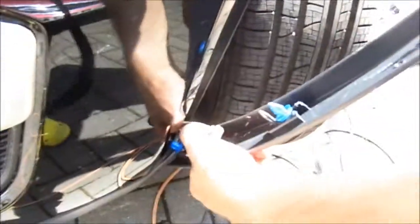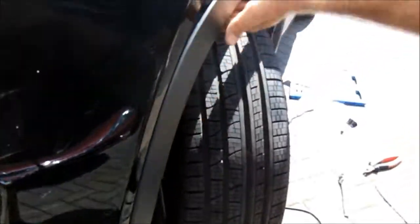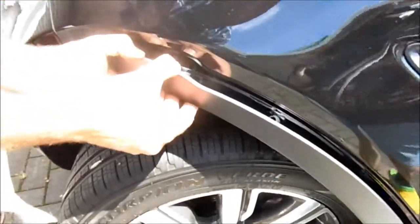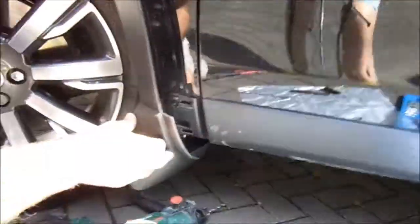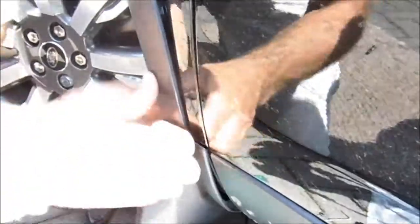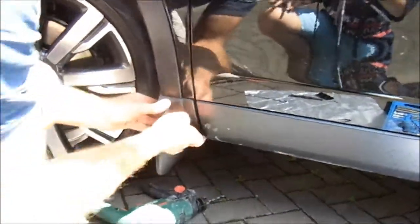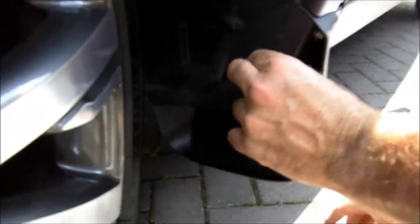So this goes in with the electrical connector to the top. There's no lip or anything on this one, so just start off working these clips slowly — one into each hole all the way around. Get to the top there — you can see there's a black guide pin that goes into that hole. Just slowly push around. Work down: this top clip here goes into there and these other clips go into the bottom. Just slowly push everything in to make sure it all fits well. Push this in at the bottom. You can see the reason we cut that hole out was to allow that clip underneath. When we do that screw back up in just a second, we'll find that will all be drawn in. And that is your wheel arch trim and your mud flap fitted.